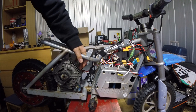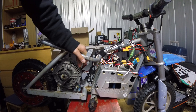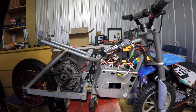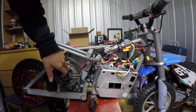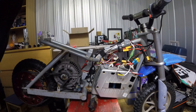It's a converted alternator — a 120-amp alternator out of a car. I'm running it with 72 volts. Rocket loads of acceleration. Still has a bit of top end, still fairly 30 kilometres an hour thereabouts. I changed the field windings to change the KV of the motor, which gives a higher RPM at the top end and obviously decreases the torque.